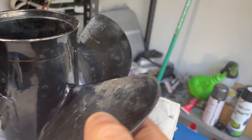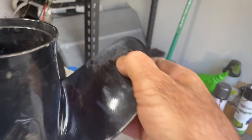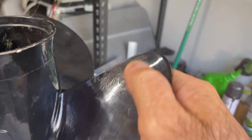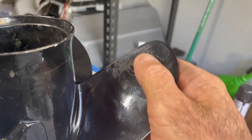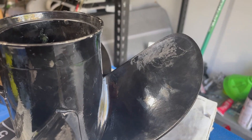So that's the cupping I've added on that prop. Like, it needs a bit of a tidy up, but like I said, I forgot to take the hammer and banging it on with a pinch bar is probably not the best thing to do it with. But yeah, it helped a lot as you can see by the video — the boat was ventilating, struggling, doing like 40-something k's an hour, and a bit of cupping and she hooked up and went — last ran about 76.